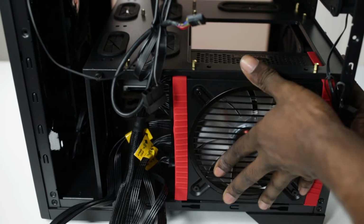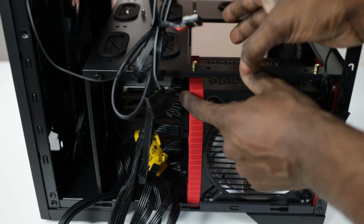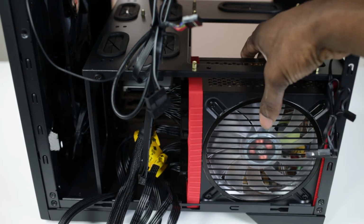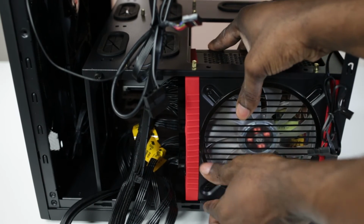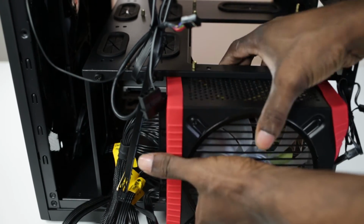The link in the description will show how big the power supply is that I'm using for this case and how to get it in there. You can go and get different manufacturers if you want, but just go by that power supply. Any bigger and you're going to have a problem. The graphics card goes up to 31 centimeters. It can't get any bigger than that, it's going to get in the way of things and cause problems. So don't go any bigger than 31 centimeters in length for the graphics card.